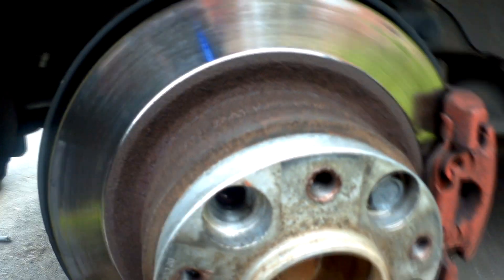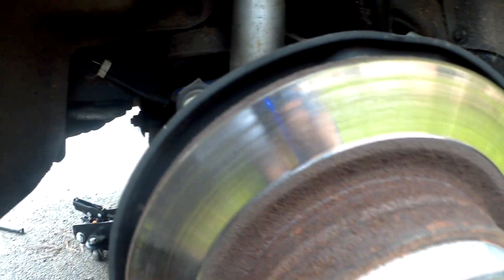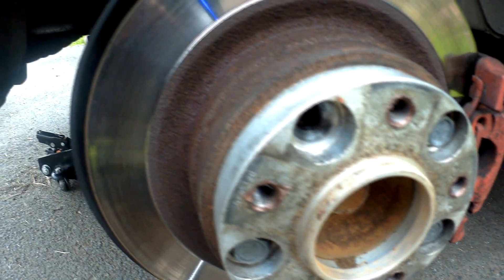There's a little star wheel in there — very hard to see on camera. You have to adjust it up or down. On the driver's side in a right-hand drive car, you actually bring the star wheel down to tighten it. Let me just double-check that.